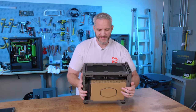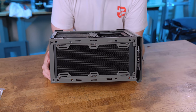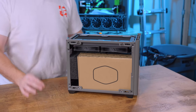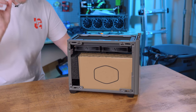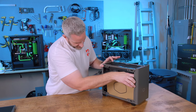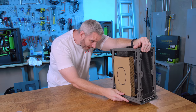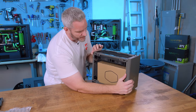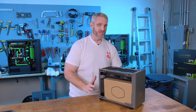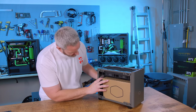Air does blow through, but it's not the most high flow. The radiators are already mounted — that's the 280mm radiator at the top. The fans are exhausting, which means it's going to take all of the hot air in the system and pull it out through the top. It is also a fully negative pressure case — there are no intake fans anywhere else, no fan mounts at the bottom. That's why all of the panels you see are mesh and filtered, because it's going to be pulling in air from anywhere it possibly can.